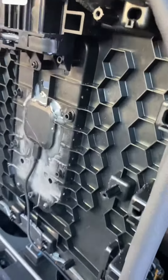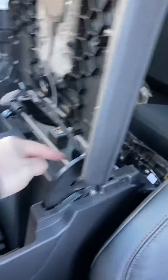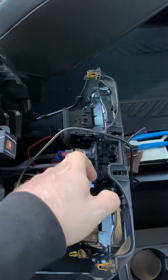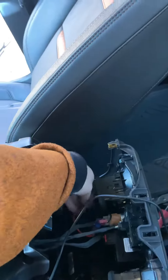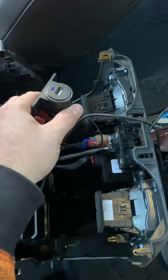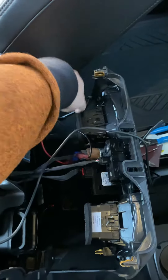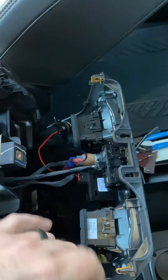So I just cut right here, epoxied it. I'm going to take the cord right here and run it down behind here. There's a cigarette lighter back here, and what I did was I tapped into the positive and negative and did a USB outlet right here, so it comes on with the car and turns off with the car.